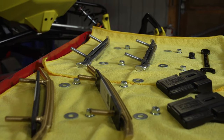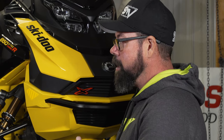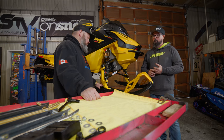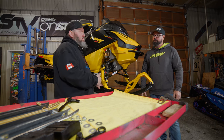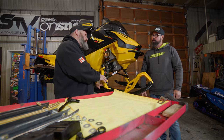Clay, you're going to do the installation of the Bergstrom products — both the good and ugly, or are we going triple points on this turbo? We're going to do both: we'll run eight-inch triples down the middle and do a four-inch good and ugly on the outside on this particular ski, which is the Pilot X ski. We'll couple that with the pre-shimmed rubber, which we'll get into once we start the install.